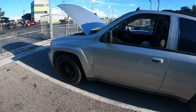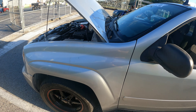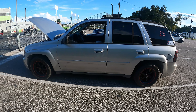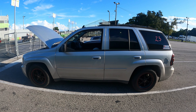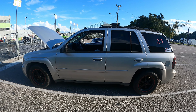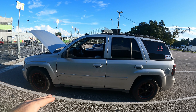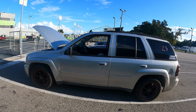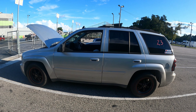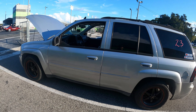Back at the track with the electric fan installed. I'm not going to lie — on the way here I got a little nervous. I thought the trans had said I don't want any more, but in the fiasco of losing trans fluid, I just did not put enough trans fluid back in. So the first time I got on it, it slipped. I steadily drove it to the auto parts store, added a quart and a half of trans fluid, left the store, got on it again — no problem. So if it's going to let go it may let go right now, but let's get into it and see if this thing really does pick up any time, any speed, or any major improvement over what it did with the mechanical fan.